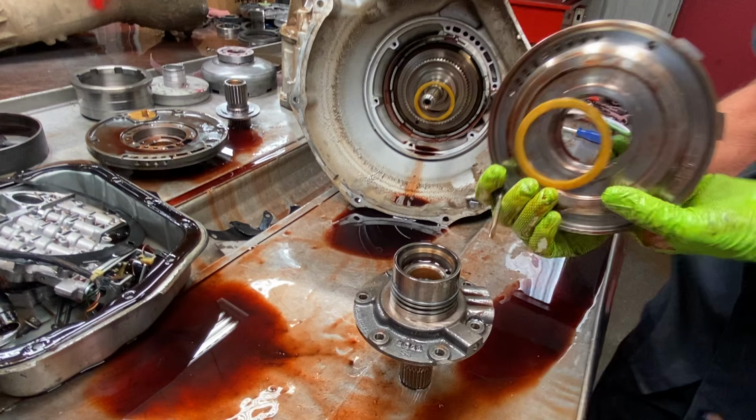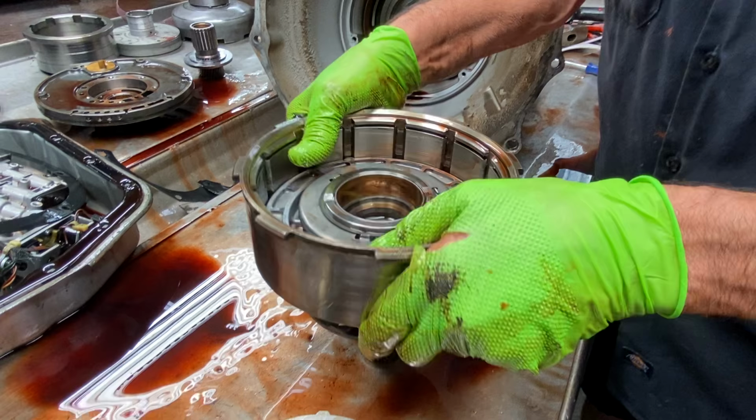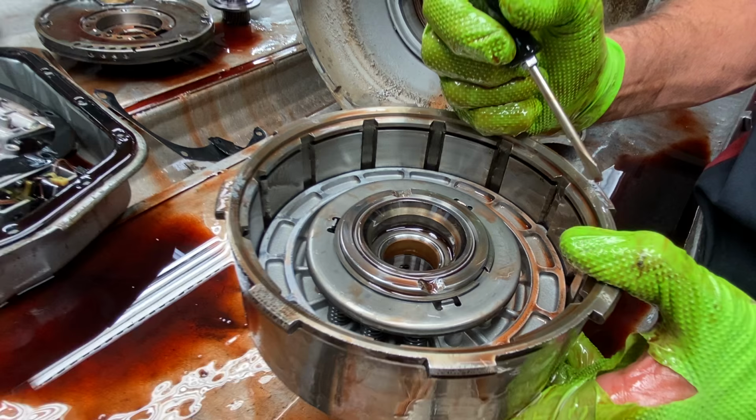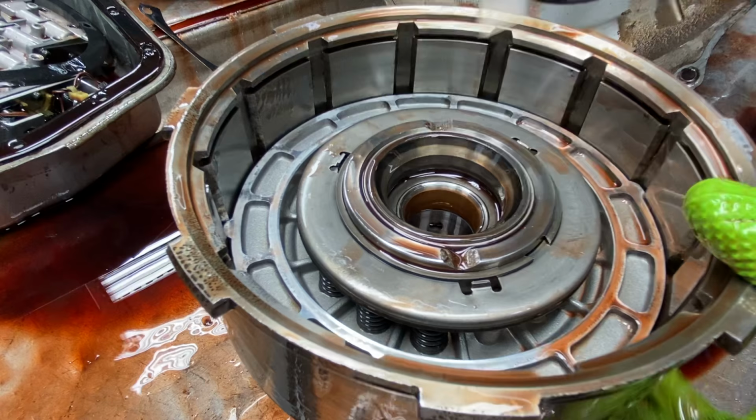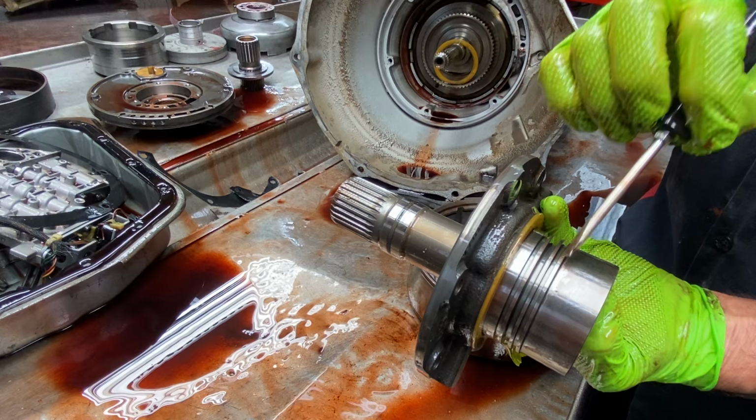You drive it so far down in there, it starts rubbing from right here on this ledge. See, because this bushing's wide, wide, wide. And if you notice right now, it's taking up every bit of that surface, and it's not even down in there. See that? So if you knock that bushing down towards flush here, thinking that way fluid can go across, you just made that bushing grind right here on this land, and next thing you know, you're going to grind right through here, see? And then your sealing ring's right there. All that metal coming here will destroy this ring.